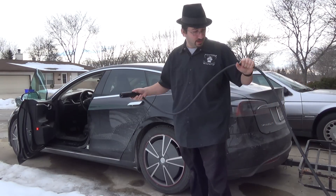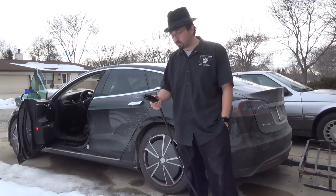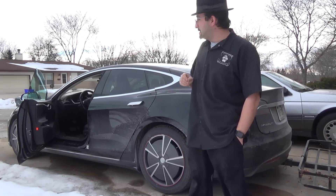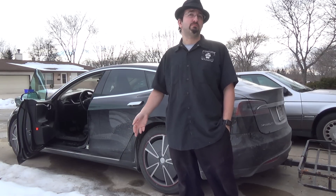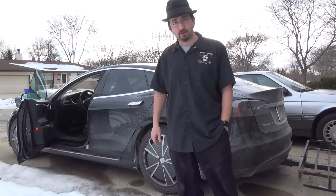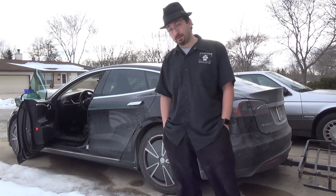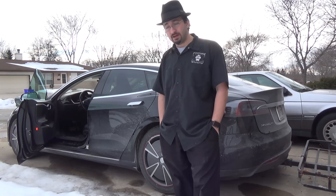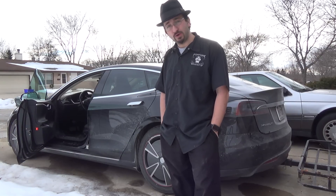So you're traveling cross-country and getting a little tired, so you stop at a supercharger — or perhaps you're out in the countryside, stopping at a high-powered wall station or campground — and you want to plug in. But it's either 130 degrees in Death Valley or negative 20 in Wisconsin. You want to keep that air conditioner or heat running. The problem is, after 30 minutes the Model S, Model X, or the upcoming Model 3 will shut that heat or air conditioner off to allow more charging. If you fall asleep, you're going to wake up either sweating or frozen like a popsicle. So I'm going to show you how to activate camper mode without it shutting off every 30 minutes.